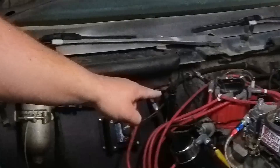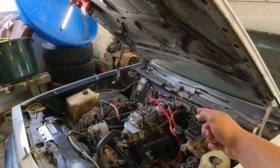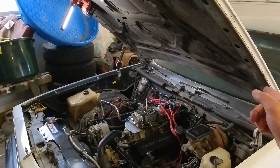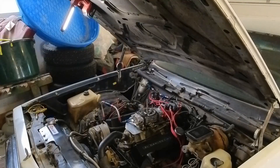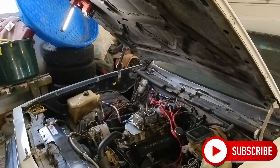The next thing I found — and anyone that's come into MSD troubleshooting has seen this problem before — is really easy. That little black connector down there: I had one of the pins get pushed out so it wasn't making contact like it needed to. Once I saw that, I pushed the pins and the connector back together and it started. So with that connector pushed back together, I was able to hit the key and have a listen.